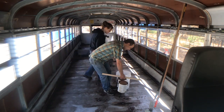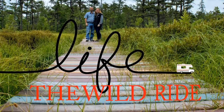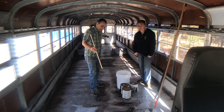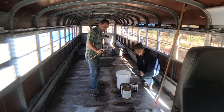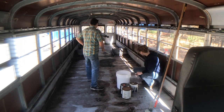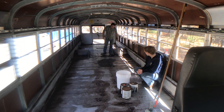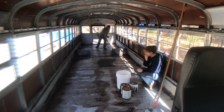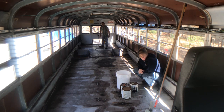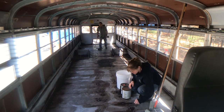It's paint day, at least for the floor. You've seen the previous videos of us rust proofing, or using rust killer. I also did a video showing me sealing up all the little holes everywhere, and I fixed these big holes back here. I went and sealed them with liquid nails and caulking. All these panels and plates around the wheel wells are all solid now. I'll take some pictures and pop them up on Instagram if you want to swing over there.